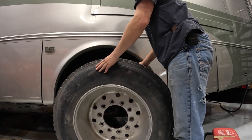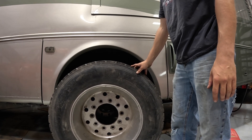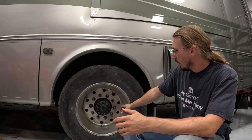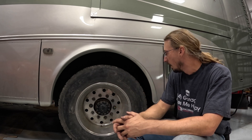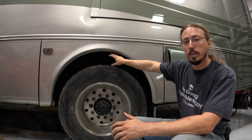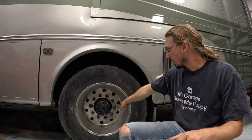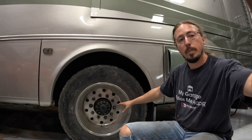Now I'm going to roll over this super single and start with the two-inch outset backspacing since that's the one I want to use. If it works, great. If it doesn't, the tires I want to use are already mounted on zero-inch offset wheels, so I can just throw those on. But I'd rather go with the two-inch outset. The first sign is really good — it's fitting in through the wheel well, which I figured it would, though the slightly bigger diameter made that a bit uncertain.